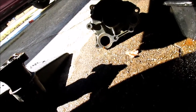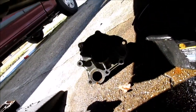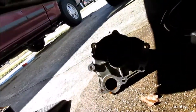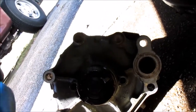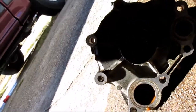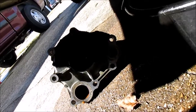Of course I spill stuff on my piece of coroplast I'm laying on to try to keep out of the crap. I should have just bought a big drain pan to drain this coolant. Once you find one with the housing, you're going to have to remove those two bolts right here and here and that will separate the water pump from the housing. Since we've got one complete with the housing, I'm not going to bother with that — but that would be the final step.